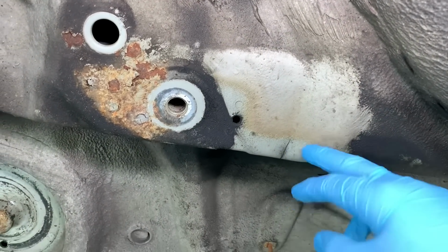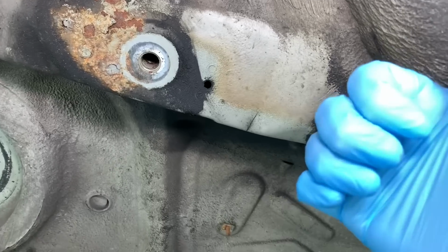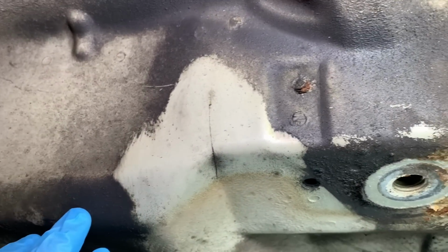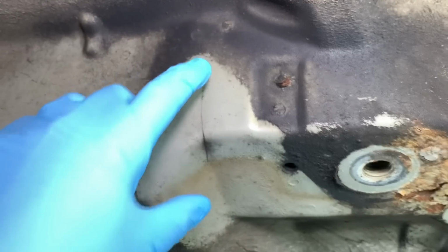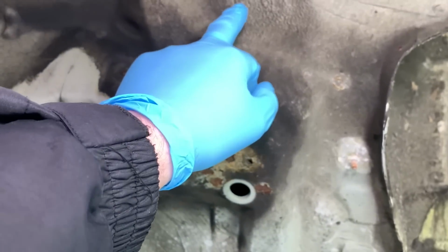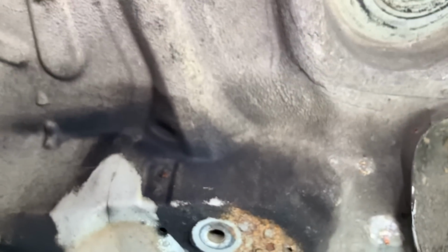The RACP, now it's apart, we can see the area we cleaned during our report. There's the crack on this side. This is the horizontal face going toward the back of the car there, front of the car over there, and then when you turn around, quite a large crack actually for a car in its late 70s mileage wise. Decent old length on that one, so we'll make sure that's stop drilled and check out all the other spot welds as well. We commonly find other spot welds in these areas that drop, so we'll check those areas.